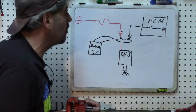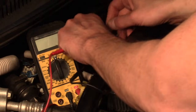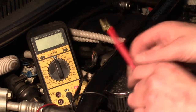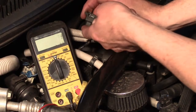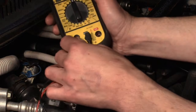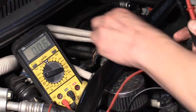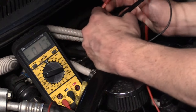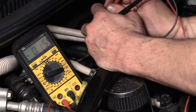Let's get that paper clip out and do this differently. Instead of checking for voltage here, we're going to see if there's amperage — which is just as good, right? If we have electrical current through this circuit, then we know we must have voltage. So we're going to go to amps mode, the 10-amp scale, and see if we have any current through this connector, which would indicate we have at least power to the connector. I'll touch my leads, start the car, and verify that we get pulses of current here.